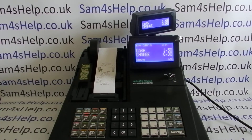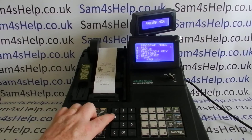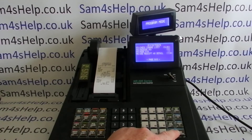To switch to receipt mode printing, all you need is the key marked P. Turn it to the PGM position, select line 4 options, press Cash to enter, press Cash to go into system, then arrow up to line 46 — 'Use receipt as detail'.